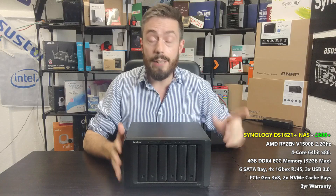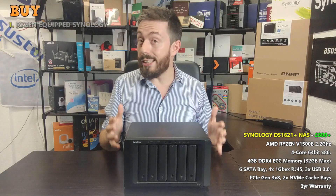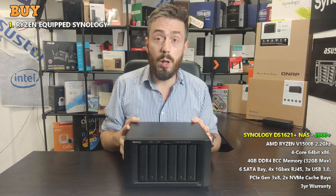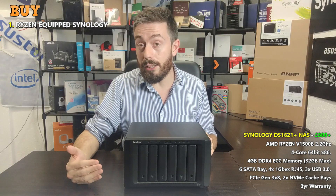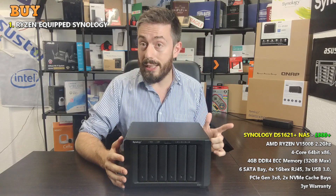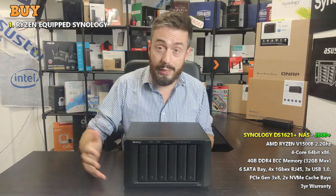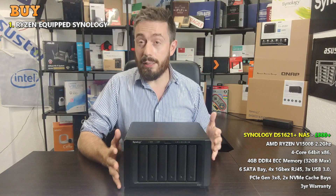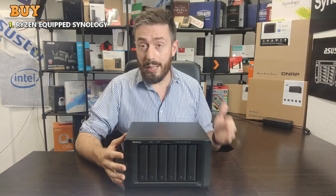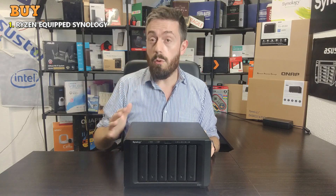The first reason that you might want to buy this NAS is quite simply Ryzen. It is the first NAS that Synology have provided with a Ryzen-based processor. It's not a high-end Ryzen, but it is still an embedded Ryzen, and Ryzen as a processor making its way into network attached storage is a very good thing. Synology's software has been in dire need of processors like Ryzen — they've embraced Xeon, Pentium, Celeron, and it was always Atom processors until recently. The power consumption versus output definitely beats other processors at this price.